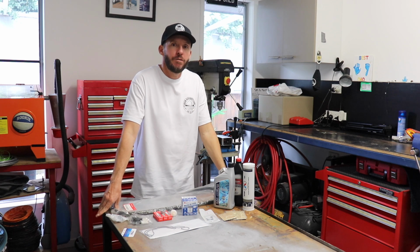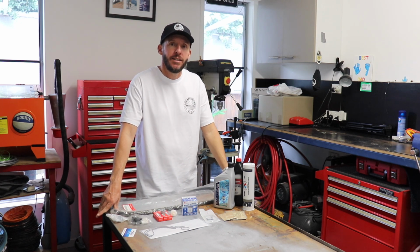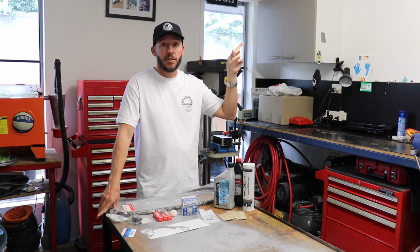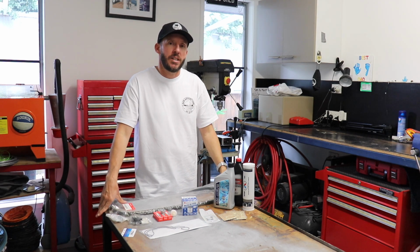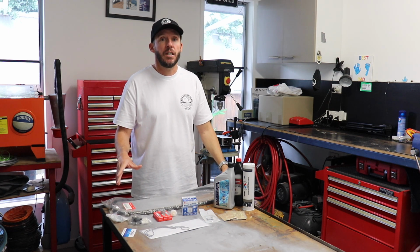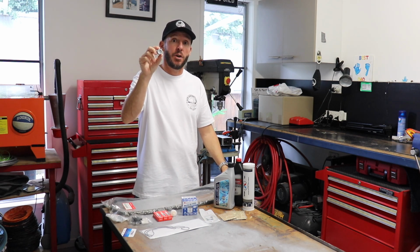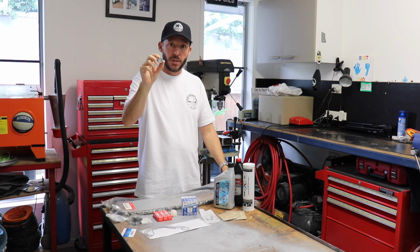Now it's been 12 months since I serviced my outboard motor last, so it's time to do it again. And if you haven't seen the video, I did make one last year, so click on the link there. I ran through pretty much everything, but there were a couple of things I skimmed over or didn't do in that last service, so I'm hoping to cover them in this year's video. So the main thing is the anodes, and in particular this internal anode, which is inside the water jacket. So I'll be replacing that this year.